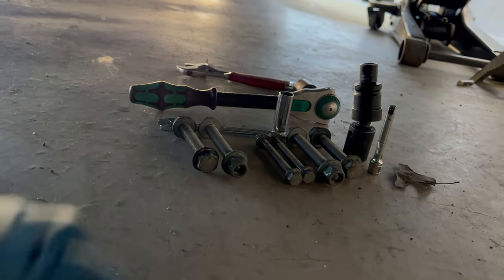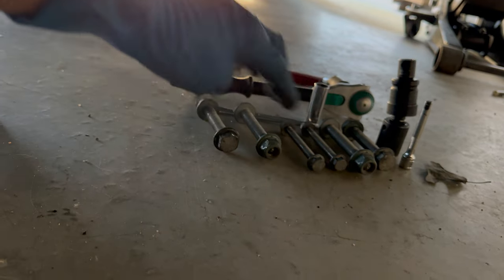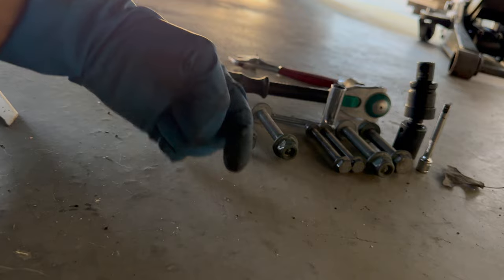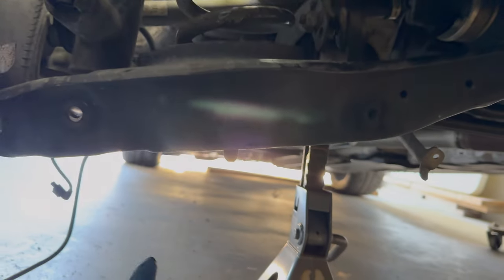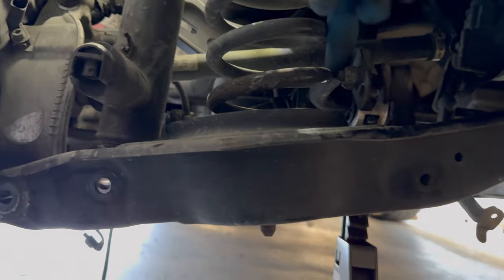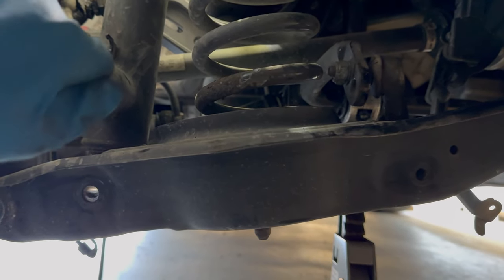You can see here, I have them laid out in order — outside, inside, 18, and then the 13. This middle 18 is the only one with the nut facing aft. The other two nuts face forward. There also are, you might have these control arm covers — two 10 mils on the bottom. And on either side they have the little push lock thing, so you have to get a little pick in there and pop them up, and then this thing just twists off.